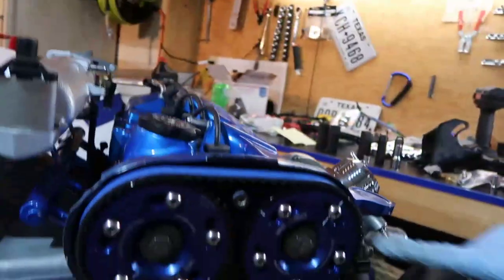But when I was tightening these screws in here, those guys, right? It wasn't tightening. It was enough to keep this here, but I'm sure if this makes 400 horsepower, 500 horsepower, 300 horsepower, I don't know, using turbo, this is going to get loose eventually and get out of time as I was driving. And I can lose my engine there. So just a little warning, if you buy used one of those things, untighten everything, see if it moves properly, and tighten it again and see if everything gets tight. Otherwise just spend $120 and buy new ones, and learn what to do.